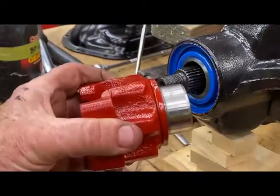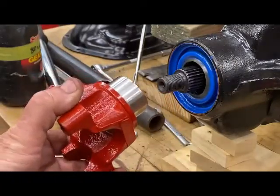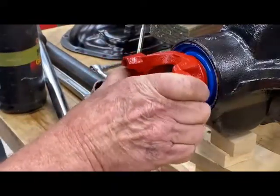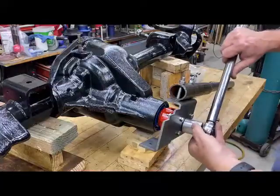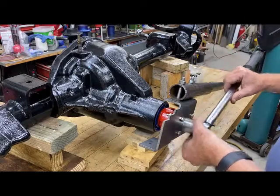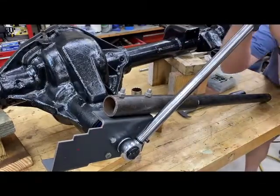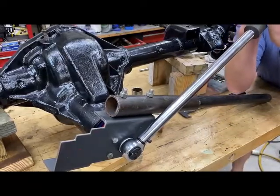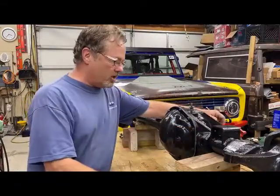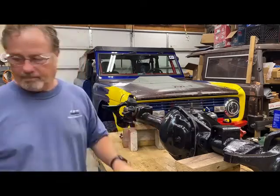The mating surface of my flange looks in good shape, but I'm going to put a little gear oil on there to make sure it's lubricated properly. With my device on here to hold the pinion stationary, I'm going to tighten it to 220 foot-pounds. I hope I sufficiently covered how you remove and install your axle and pinion seals. Be sure to like the video, subscribe, and share. Thank you.